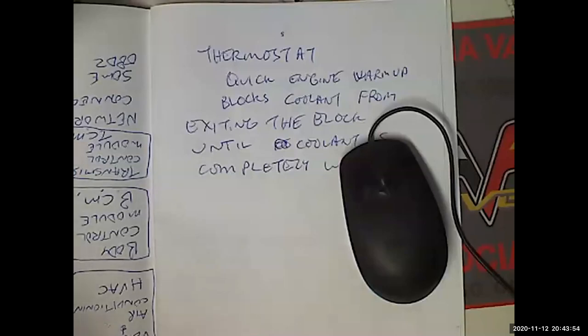bear. Now, let's remember, the enemies of rubber are heat and oil. So what happens very, very commonly is somebody gets a power steering leak, bad hose, something like that, and it starts dumping fluid. And they're like, well, I can just keep refilling the reservoir, which is true. But the problem is all that hot, dirty oil goes after your engine or transmission mounts. And a lot of those are very painful to change.